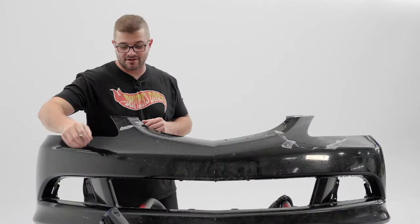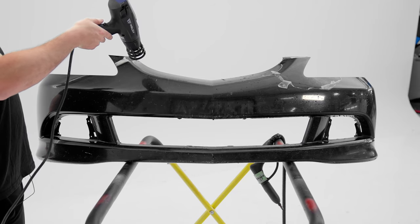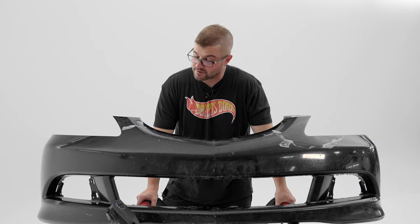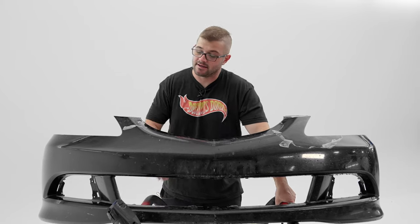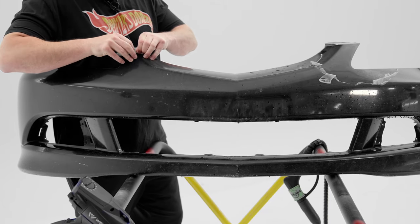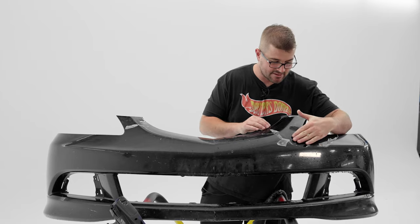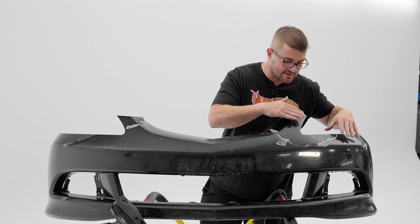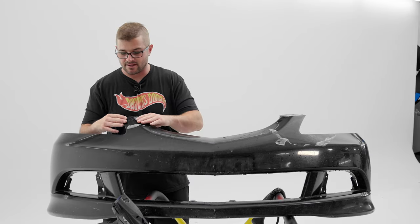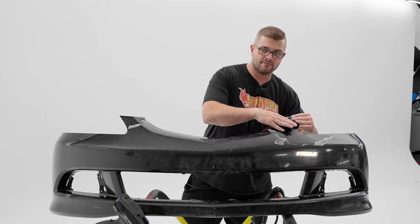Saw from the montage there, I busted out the heat gun because I wanted to do a comparison to see, does the heat gun actually go any faster than the steamer? And at first, it was going pretty quick, I'm not gonna lie. I heated everything up and was able to start peeling everything back, but I was able to instantly notice the amount of adhesive left over in comparison to the steam side. The steamer side has a very light dusting of adhesive, that's gonna come off almost immediately. This side over here, it is caked on. And so I can feel the tackiness on my hand here, over here, no tackiness.